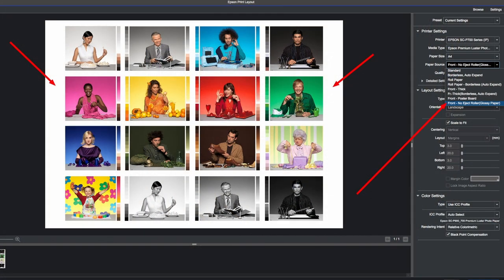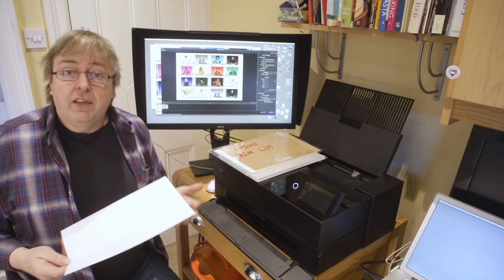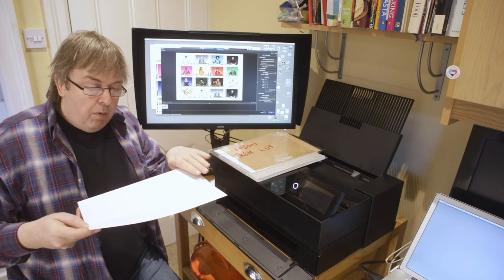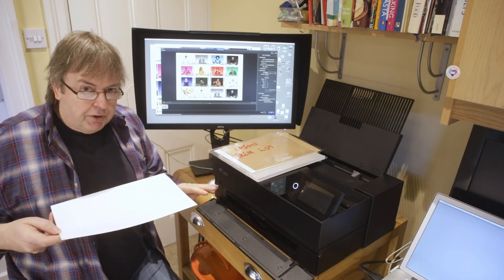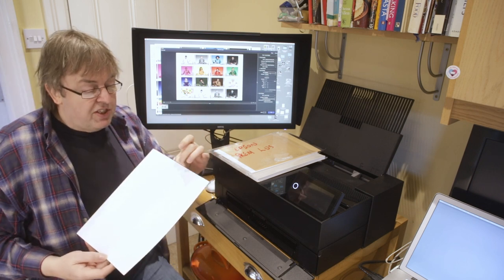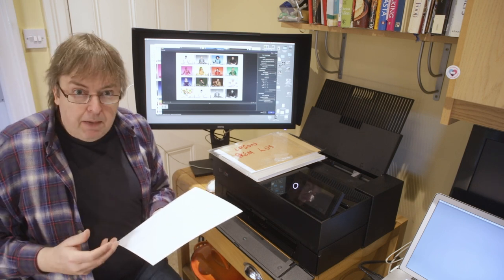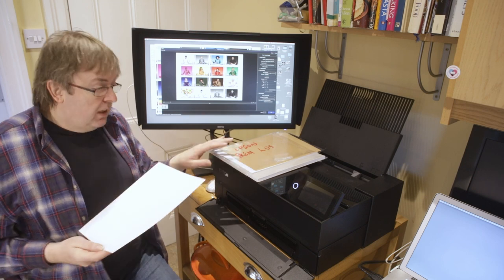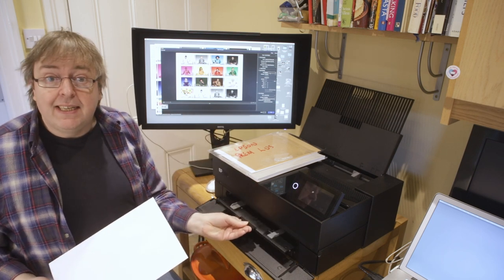You'll notice the image has got smaller. One of the reasons that the various rollers are present in the printer is to allow borderless printing. With a rear roller feeding the paper, there comes a point where the paper has left that roller but you still need to print the edge — that's where the front roller draws things through. If you just use the rear roller you're limited in coverage, and in fact you can see here there is an enforced two-centimetre margin. If you want a bigger picture you need bigger paper — you still get the two-centimetre margin but proportionally it's less. That's only on this particular setting; you can print borderless on other settings, but on this one the margin applies.